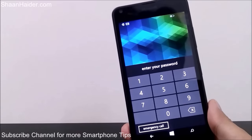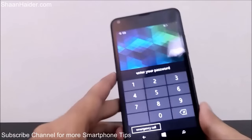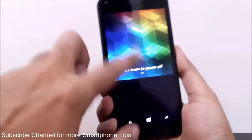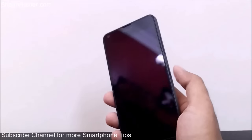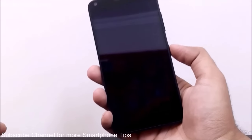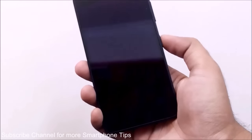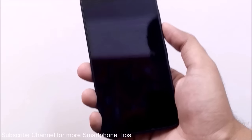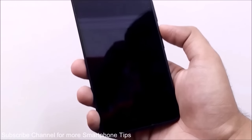With your Microsoft Lumia 640 or any Windows Phone 8.1 device — so how to get rid of this problem? The process is pretty easy. First of all, switch off the device. Once the device is turned off, turn it on again using the power key, and press and hold the power key until the device vibrates. Once it vibrates, move your thumb or finger from the power key to the volume down key and press and hold the volume down key until the exclamation mark comes on the screen. Once the exclamation mark is there, you have to perform a key combination.